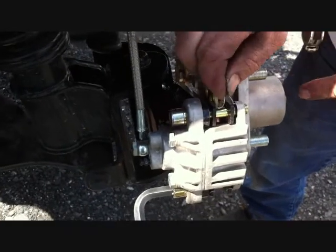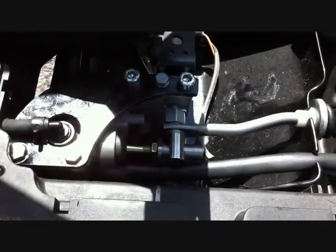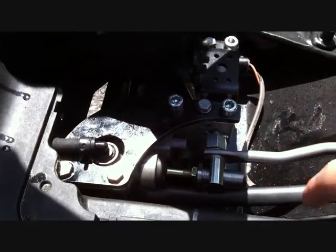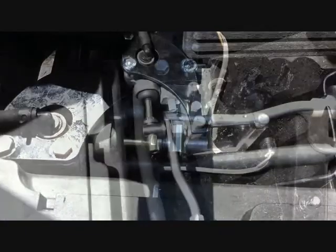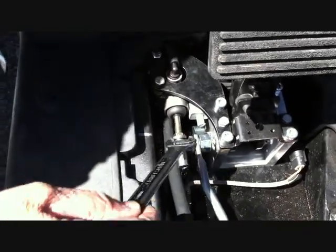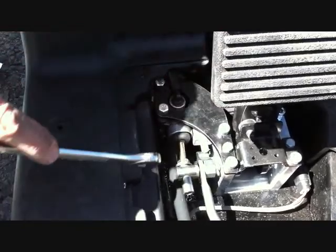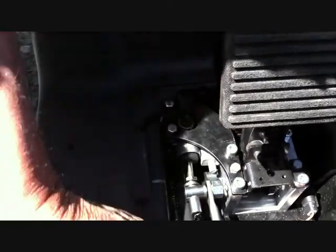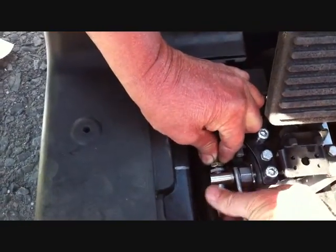Install your safety clips to the slider bolts, pushing down inside and clipping onto the slider bolt as shown. You can adjust the bias of the brakes for more or less front brake: loosen the jam nut and spin the adjuster back for more front brake or spin it in for less front brake, then re-tighten the jam nut. To adjust, use a 16mm to hold the adjuster and a 13mm wrench to back off the jam nut. Thread the adjuster toward the front of the car for less front brake, or toward the rear for more front brake. Once at the desired position, re-tighten the jam nut.